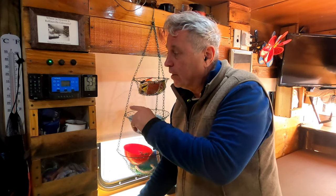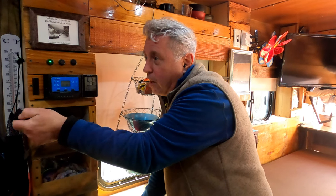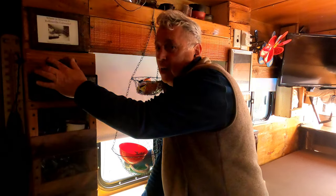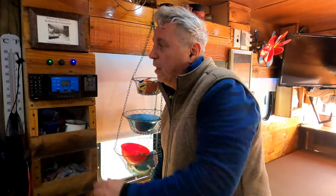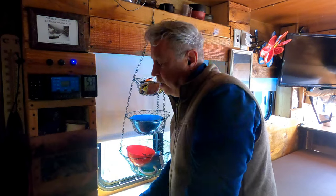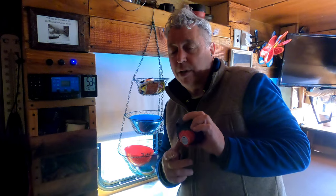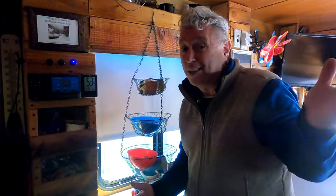The indoor-outdoor temperature monitor has a clock — that's great. The controller is here; I keep the stereo remote on velcro. The DC panel — all the fuses for everything wired in here — is behind these two screws. The wiring comes in here and goes underneath to the batteries. I'm going to add a battery shut-off switch, something I should have done from the beginning — right now all I'd have to do is unplug the solar panel. The electric is separate from the DC and we use mainly the DC.